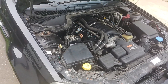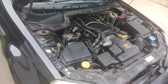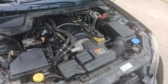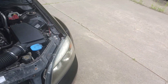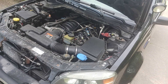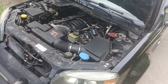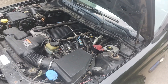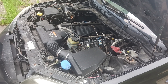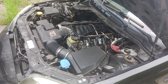Just a work car beater. I'm getting the parts for it — I have the cam, lifters, push rods, and updated rocker arms. I have a run in it, put about another 1,000 miles on it, and when you're driving around the oil pressure builds up from the 10W60 in there. It puts it to pretty much dead silent — you don't even hear it. You don't hear any tapping or anything other than the injectors. Runs great.